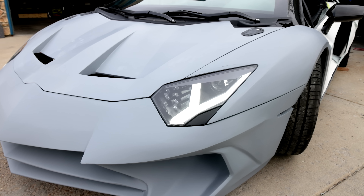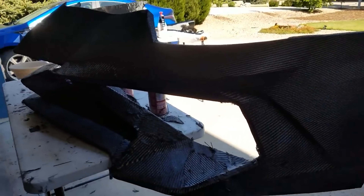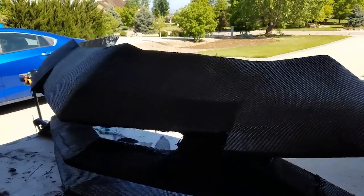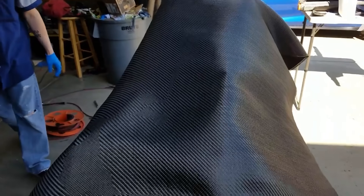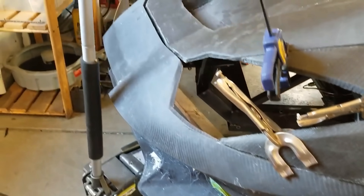It's much larger than a CR-10S, so you have to do it in pieces, and we used PMMA to chemically weld it together. We wanted to give the car and the body as strong a structure as we could, like if you were doing metal or fiberglass. It's going to be on the road out in the environment. So what we decided to do was encapsulate all of the 3D prints in carbon fiber — three layers on top, three layers on the bottom. Then we put it into a vacuum bag and use atmospheric pressure to crush it down, feed in epoxy into the other end, let it cure, and then we have a part.